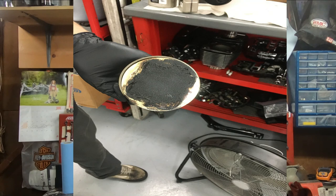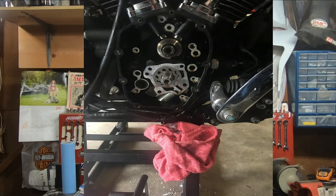That's been a lot of the issue with the Milwaukee 8: rings, the oil pump, and too much crank pressure. And guys, crank pressure just isn't a Milwaukee 8 issue. This can happen to a twin cam or a Sportster engine as well. So while the Milwaukee 8 really brought the sumping issue to life, bear in mind, this can happen on a twin cam or a Sportster. It just depends on the mileage, condition of the engine, and what's going on there.